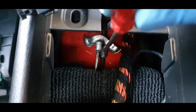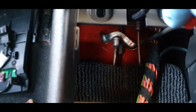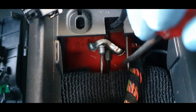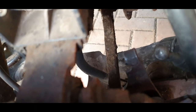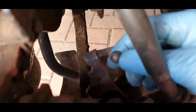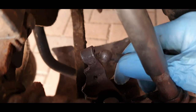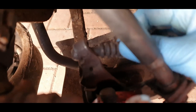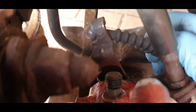I've taken them off — this side I didn't have an issue with. The other side is already up there — this is the issue I had, because this is the longer cable and shorter at the brake. What I'll do now is pull that cable to length, hook it onto the brake caliper, and then adjust this to the desired length. The issue I had was I couldn't pull this onto this, but now that I've slackened off the handbrake I should be able to — there we go! That is on there. The handbrake is on.